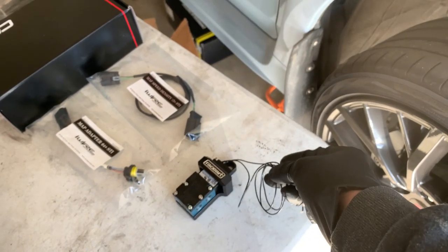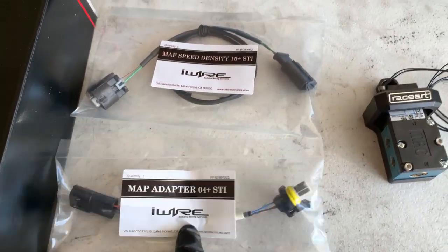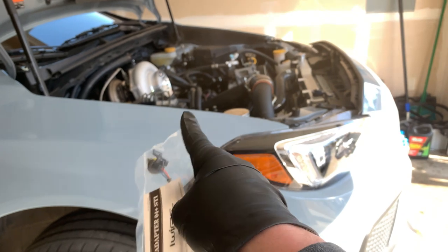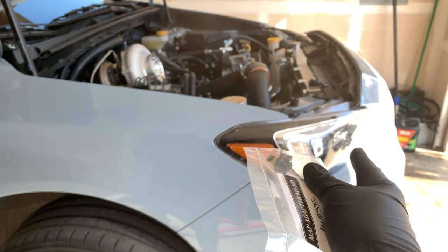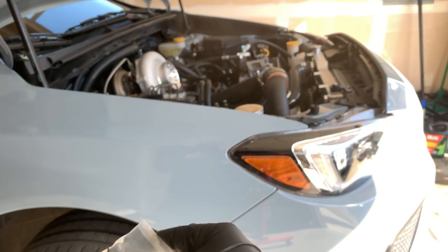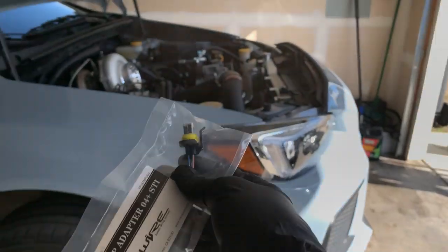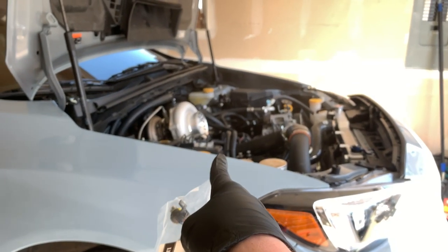These are non-polarity — it doesn't matter which wire you hook up, it will read. Also, this will be my first time using iWires — it looks like a really nice product. We are using the AEM 5-bar MAP sensor on this car because we plan on going over 40 pounds of boost. The Cobb 4-bar would work up to a point, but a MAP sensor has to account for 14.5 PSI for vacuum, so that eats up 14.5 PSI of that sensor's range. On a 4-bar MAP sensor, each bar is roughly 14.3–14.5 PSI — add those up and that's what the sensor can safely read. So we're just going to do a 5-bar, which is what I run on everything including Hyper Blue. We have this adapter that just plugs in and adapts over to the AEM connector so we don't have to cut up the wire harness.